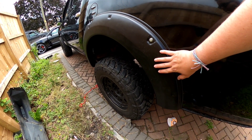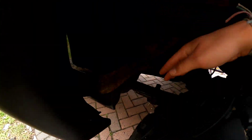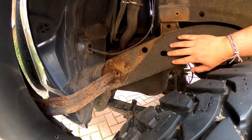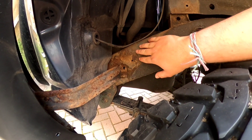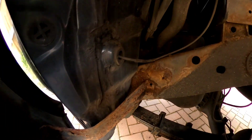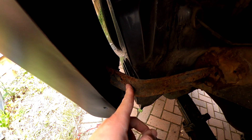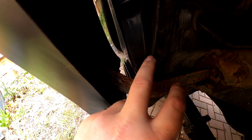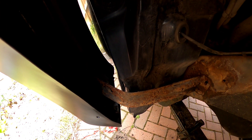Underneath here we only found good things — there was no rust on the arches, which is good. Now I've got a bit on the brace here, which is where it hasn't been sprayed. This is going to need to be under-sealed properly where the arch sits. This one here is probably going to need to be replaced at some point — it's not really very good. This is what holds the end of the bed up at the chassis, and the one on the other side is much worse, so you'll see in just a minute the issue I've got with that one.